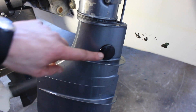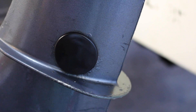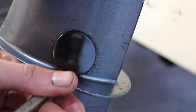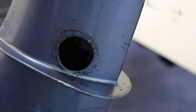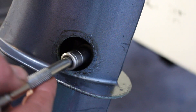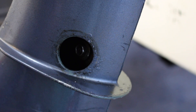The first thing we're going to do is remove this rubber grommet, which lives about halfway up the leg. We need to pop the engine into reverse, and that reveals the bolt that connects onto the shift linkage. We're going to loosen this just a little bit, and that frees up the shift arm from the arm that goes down to the lower unit.